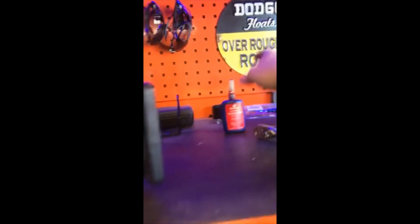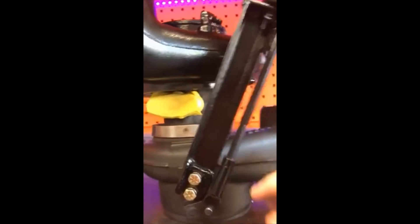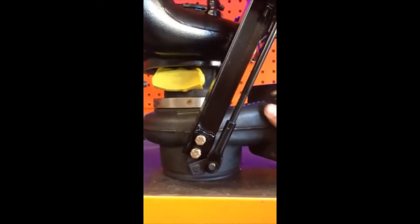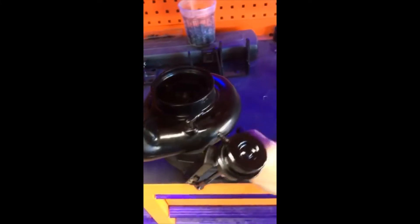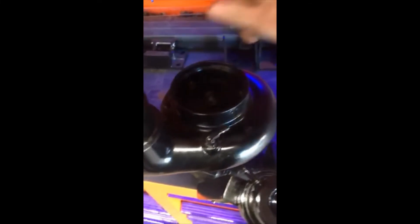Here it is bolted up. I'll use a little red Loctite on these — they get real tight. Good 1/4 inch to 3/8 of engagement. This setup works pretty well. It's worked well in the past for me on 351s. This is a 341 for a compound setup, so it'll be fine with that smaller compressor wheel.